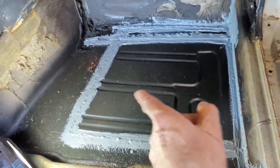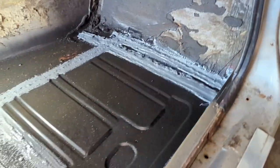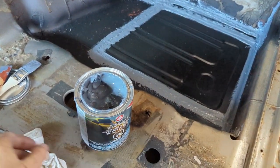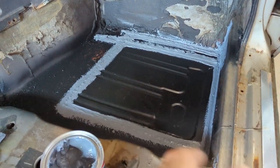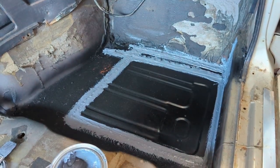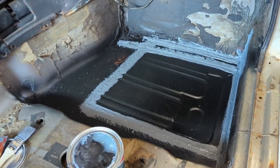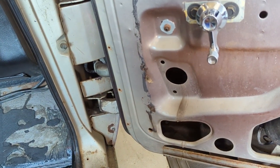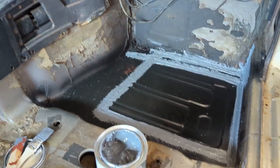I'll let that dry a bit and then hit it with some more black paint. I painted it already — and underneath I hit it with some asphalt guard. I ground it all off and the car sits very low so it was hard to film, but it's done underneath. I'll put the seam sealer away, and then I'll start putting the sound deadening material down and get the carpet and seat back in, then start putting the whole interior back together. All right guys, thanks for watching, everybody stay well, and we'll see you in the next one.